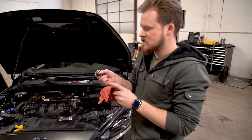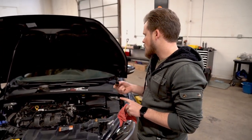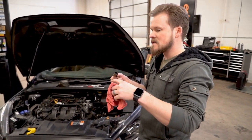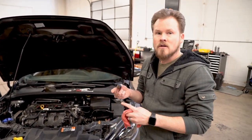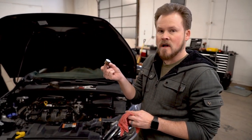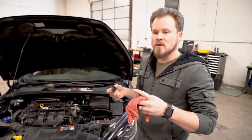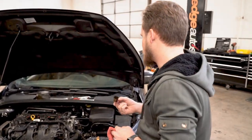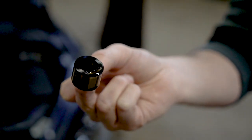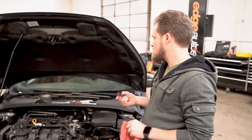It's suggested that you check your cam follower and make sure there's no wear on it while you've got it out. We're also going to check where it's at on the cam lobe right now, because when we put the new pump in we want it to be on the flat part of the cam lobe. On the ST it's a three-lobe, triangle-shaped cam profile for the follower and for the high pressure pump. You don't want it on a peak — you want it on a flat spot when you put it in. It makes it a lot easier to get the pump in. Our cam follower does not appear to have any wear that would be concerning, so we're going to peek back there and make sure the cam is in the right position to put the new pump in.